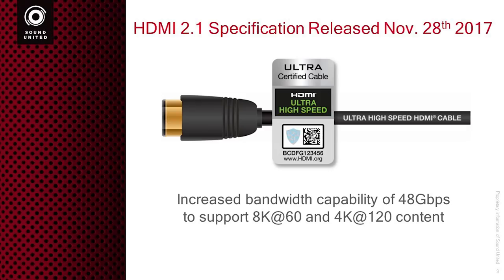It's an HDMI Forum thing, and it doesn't matter. What's in the name? It just doesn't matter. But it's the 2.1, the 2.0, that's a huge difference. But yeah, I will tell you that you're not even going to see 2.0 or 3.0 or 2.1 or something, because manufacturers can't use that terminology. Right. So what you're going to see is, back in the day, 2.0 was high speed. Right. Now, 2.1 is ultra high speed. Either you're going to see ultra high speed on your box for your cable, or you're going to see the frame rates and resolutions that are supported. So that 2.1, 1.4, 2.0B stuff we talked about is more of an industry insider thing, but you won't see it on any boxes because we are not allowed to use it.